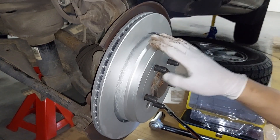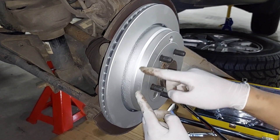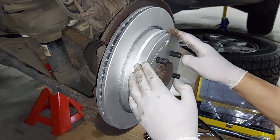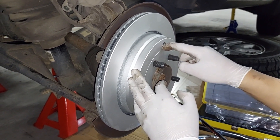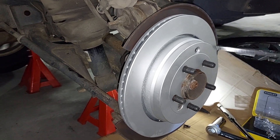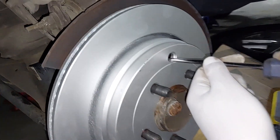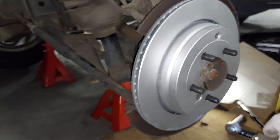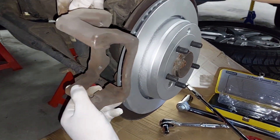I've finally done that adjustment — between 40 and 90 Newton metres — it started clicking from 40 up to 60, 70, and didn't pass 90, which is what's required. After that's done I loosened it by exactly 8 clicks. Now I'll mount the caliper bracket.